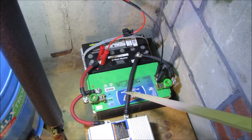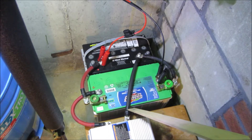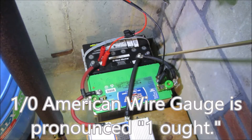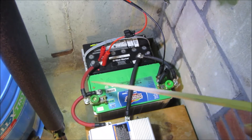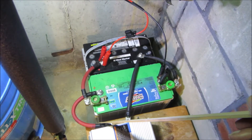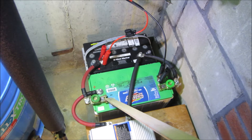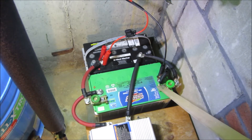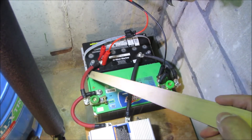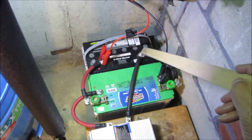Here's how I did it. The system consists of four battery cables: we have this longer black one here, looks like about a one-foot one-aught cable; a shorter nine-inch one-aught cable; and then a pair of nine-inch cables on this side. So we have a total of four battery cables and two battery disconnect switches — one here, one here. In order for the front battery to work, the positive comes right into the inverter, but the negative has to go all the way to the back battery.